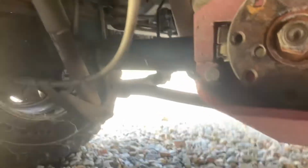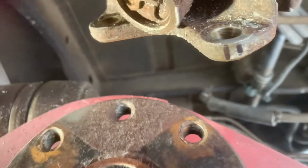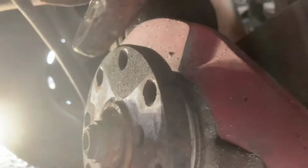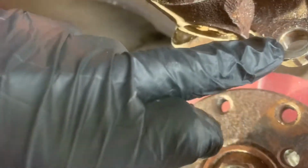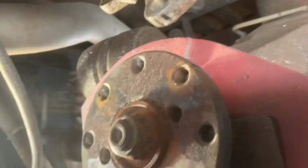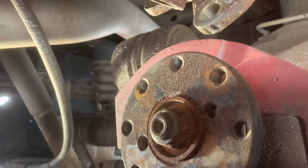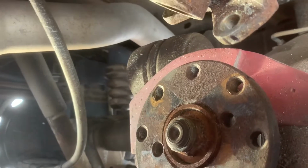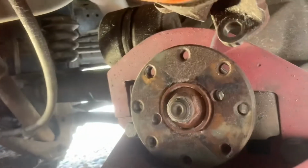I'm going to bring you over to here. If you can see, I got some marks on the drive shaft, which, let's see, you can kind of see them. Oh, here we go. So I got one there. This one here was two. So I indexed the drive shaft to the coupling to make sure there was no balance issues. It's very easy to do with a marker. Actually much better with indexing paint, which you could just use any kind of paint, which I'll be doing afterwards on here, because this will be pulled one more time for a 3,000-mile journey.